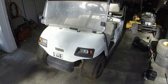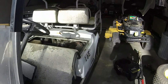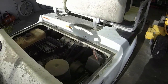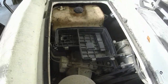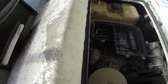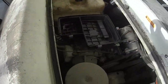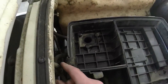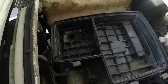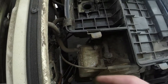We think this is around a mid-90s model — like '95 or '96. You've got your whole setup right here. Obviously it's been sitting a while. We've got corroded battery terminals and things along those lines. I've already taken the seat out and the air filter. The air filter actually looks pretty clean. The fuel lines are pretty hard — we might have to replace some. And we've got the choke set up here.